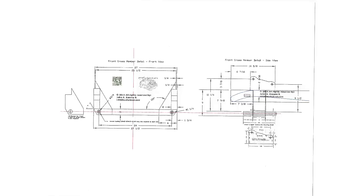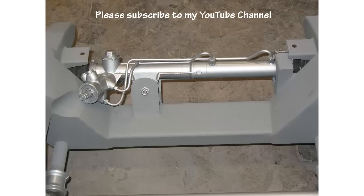For the lower control arm mounts, I used precision tubing that had an outside diameter of 1.25 inches and an inside diameter of 3/4 inch. I then pressed in bronze bushings at each end of these control arms that had an inside diameter of 1/2 inch. In this view, you will see the front rad mounts and the steering rack mounted to the crossmember.